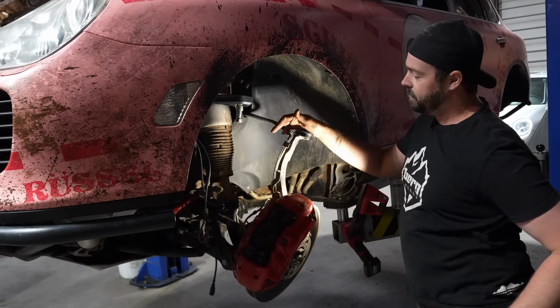You guys don't have adjustment in the links too? No, you don't. But you can adjust in calibration. What we have it set up at is from center of wheel to fender about 21 inches in the front. And that's the high setting or mid setting? That's normal. Normal? Yeah, mid. Okay. Yep. All right. Sweet.